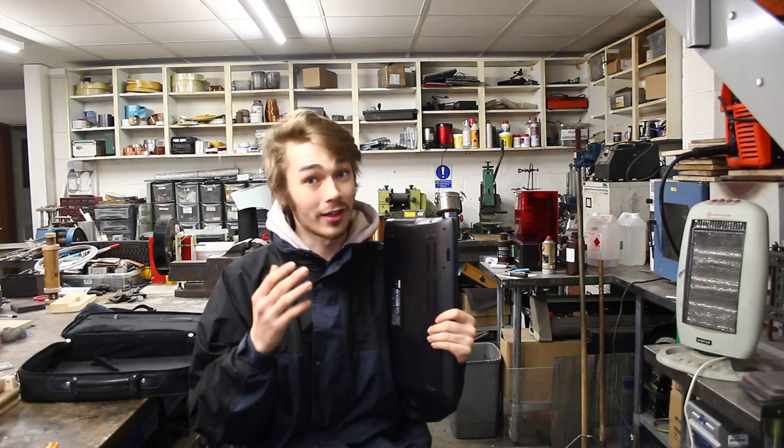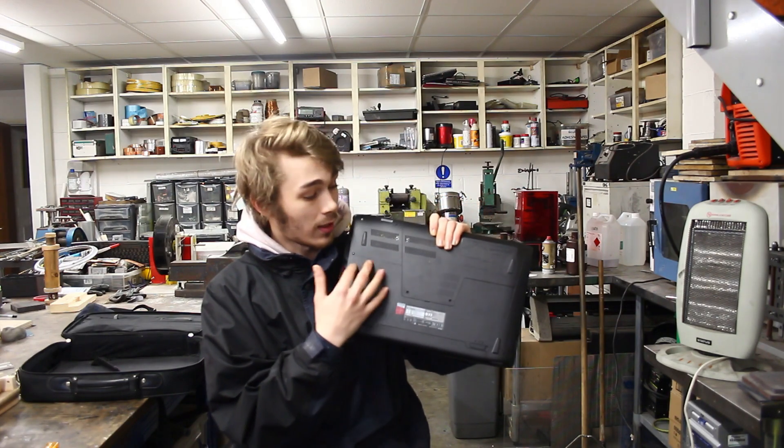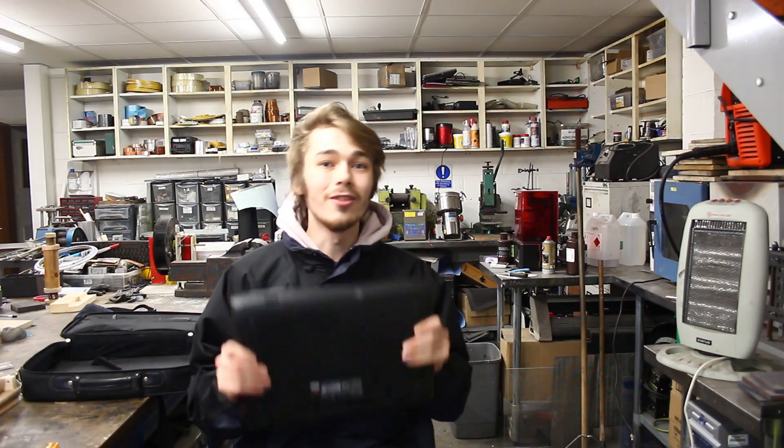So the person that gave this to me only wants one thing. They don't want the laptop back, but they want the files off this laptop. And there's two ways that you can do this. The first way I'll explain because that's not what we're actually going to be doing, and the second way I'll actually show you. So the first way is that you can actually remove the hard drive from the bottom by undoing these screws, stick it in a desktop setup in your computer, and that way you're able to transfer all of the files onto a folder on your actual computer. And that's a very sped through run through of that.